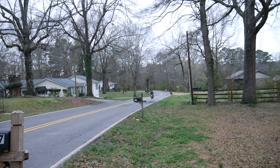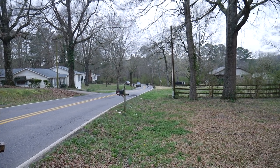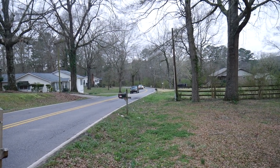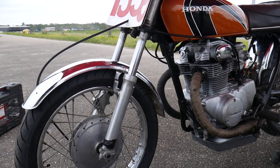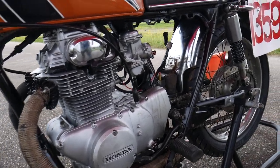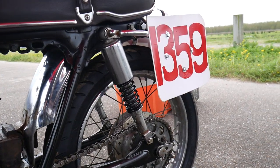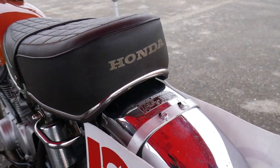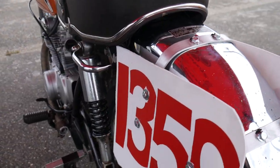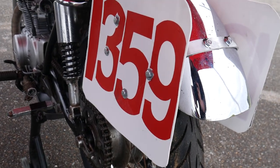I'll go over the bike, but none of the race prep was filmed. It mainly consisted of number plates, safety wiring, and fabbing a catch can. Here's the race bike in all her glory with the number plates and everything mounted. You can't see all the safety wire that's done, but Adam painstakingly drilled out all liquid-holding bolts. The number plates are mounted to the rear fender where the tail light used to mount — we just used aluminum bar stock and bent it over the tail.